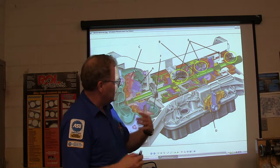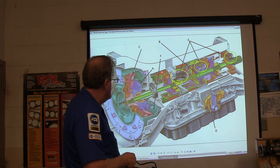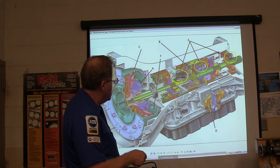This will become clear as we get out there and get our hands on a transmission. These are drums — the green parts are drums, the red part is a band, and this is an output shaft. You might notice the output shafts and the input shafts are not connected together except through all of these clutches and bands.